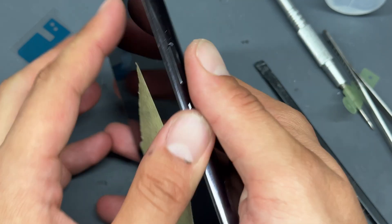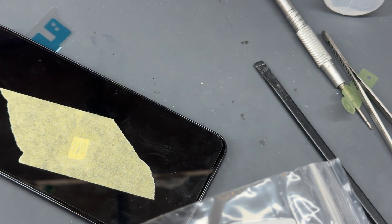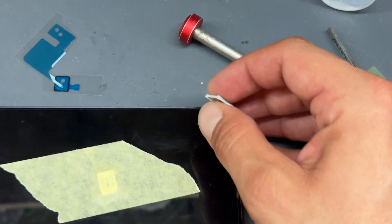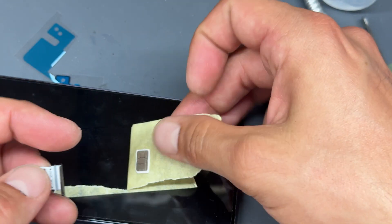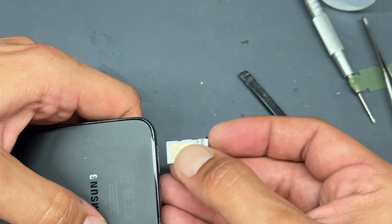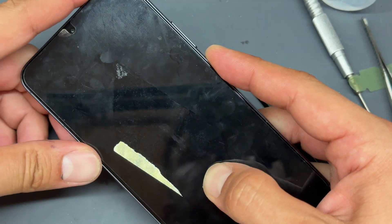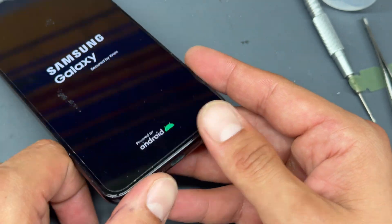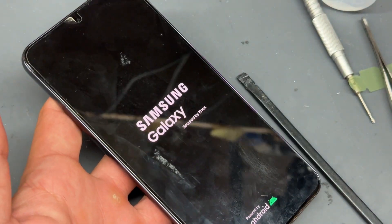You can see this repair is now complete. All that's left to do — because the customer damaged their SIM card tray as well — I had to order one of those, they're about £3 including VAT. A little tip: just stick SIM cards to phones so you don't lose them. Don't forget to put your SIM in the bottom of the device now, the right way around, just like that. Turn the phone back on, make sure that it all works and picks up SIM. You also want to make sure you're testing the microphones and loudspeaker as well. That just about completes this repair — thank you for watching and I will see you in the next video.